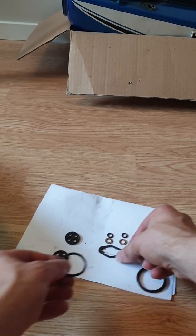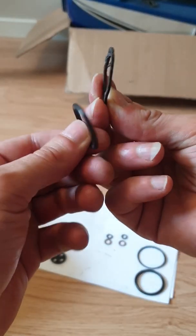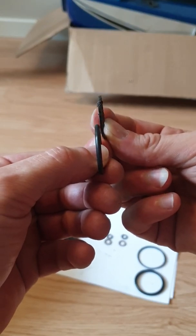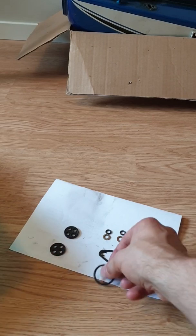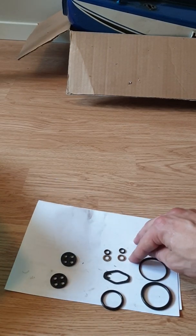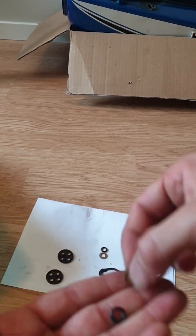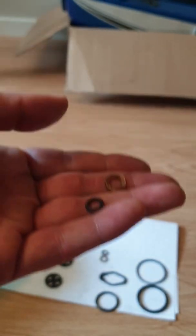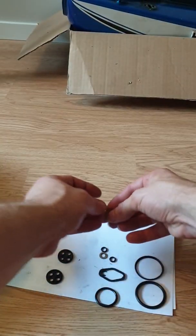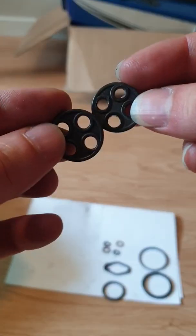Is this one. It's also a very old date. I don't know if you can see the thickness, it's almost gone here, man. And these ones are supposed to go around the screws holding the petcock into the gasoline tank. You can see here the difference, thickness and everything. So it's good to be changed, and this is the old versus the new gasket underneath the tap.